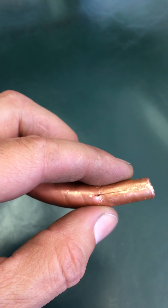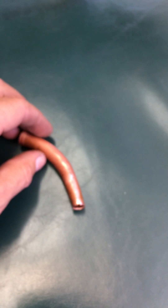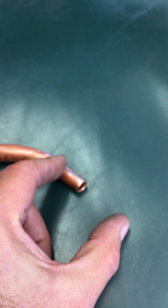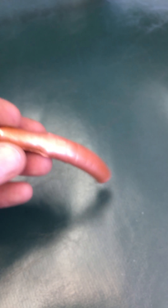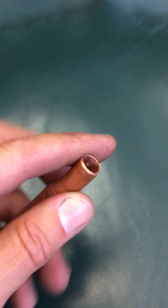All I'm getting ready to do now is solder the other side. The vacuum hose is going to fit over that end, sticking out about another inch, and that part goes into the tube on the back of the carburetor — so the two tubes meet up right in the middle and the hose joins them. This end then shoots off toward the brake booster, and the hose from the brake booster fits over this part, maybe with a little clamp. And that's your adapter to change the hose size without too much trouble. Thanks for watching.